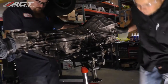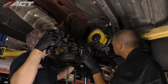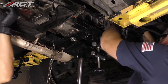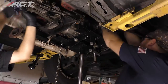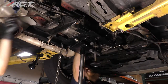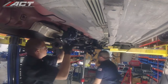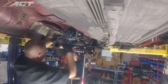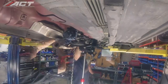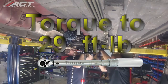Lift the transmission back into place. Install the starter and tighten the bolts to 22 to 30 foot-pounds. Install two bolts in the bell housing, one on each side just above the dowel pins, and torque them to 36 foot-pounds. With the transmission lowered a few inches, install the uppermost bell housing bolts and torque them to 36 foot-pounds. Install the remaining lower bell housing nuts and bolts, then torque them to 29 foot-pounds.